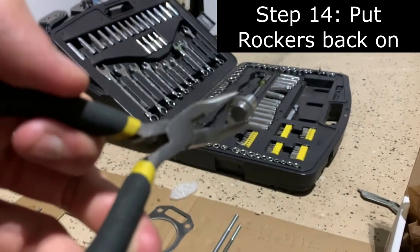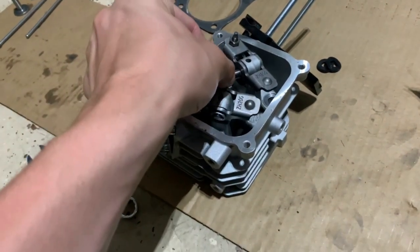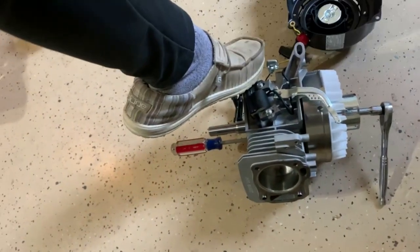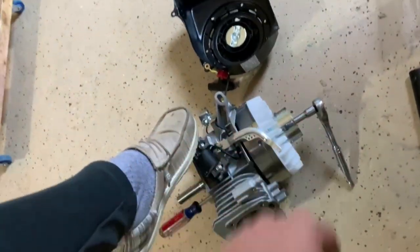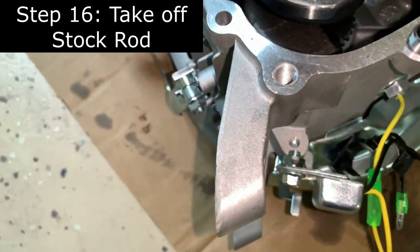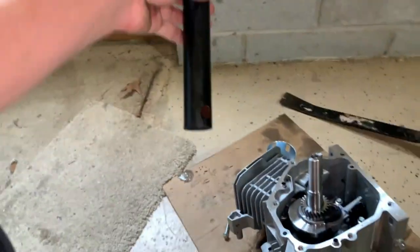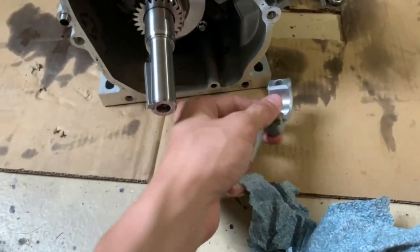Using a pair of pliers, clamp the little C-clips back on and put them back through the rockers to get everything back in place. To remove the flywheel without the proper tool, you can jam a flathead screwdriver in there to stop it spinning, then use a big torque bar and put your foot down for enough torque to break the nut. The next step is to loosen the nuts holding the connecting rod - that was not easy at all. I had to use a huge bar on a tiny wrench to pry those loose.